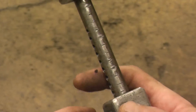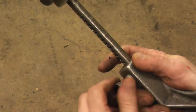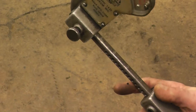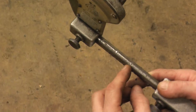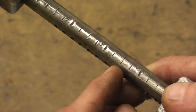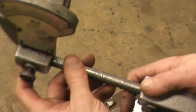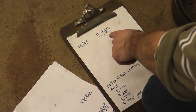The alignment can be done with the lines on the gauge. We'll loosen this off, and you can see that it lines up with our self-aligning pin, which will always line up into one of these positions. So we're at 9 here, then 9.25, 9.50, and 9.750.